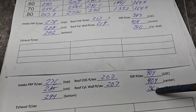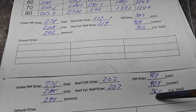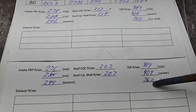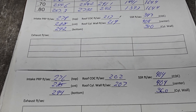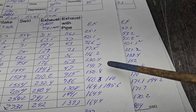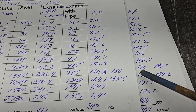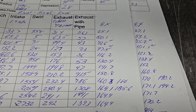That is probably why we have that reversal on our swirl, because the short side works better on this side of the bowl, probably due to casting thickness more than anything else. I was able to give it a little more — I was able to do the short side more evenly from side to side. Number three exhaust and number four exhaust: number four exhaust works a little bit better everywhere — decent distance difference: 160, 170, 180, 190 versus 164, 171, 185, 194.